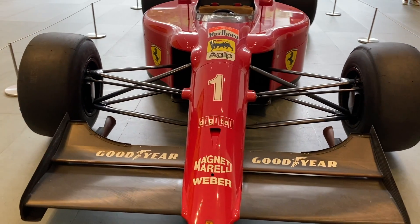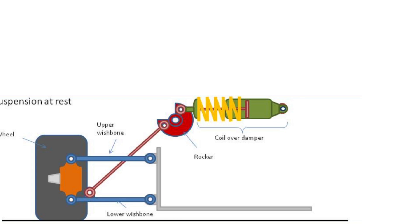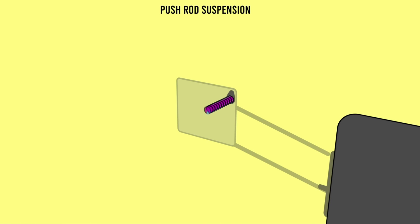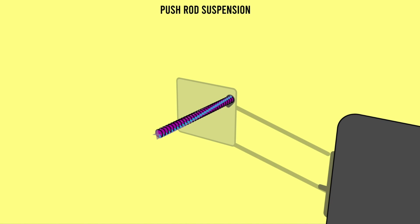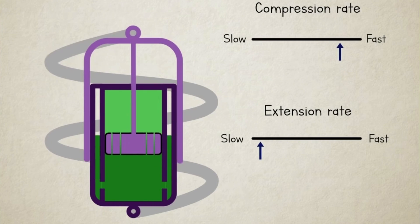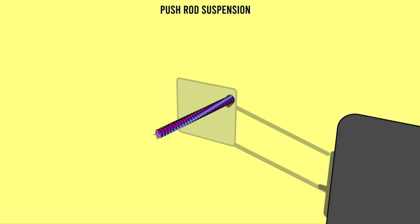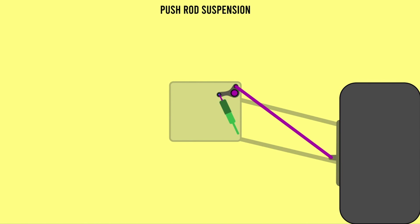We are looking at the front end of the car. Wheels are structurally mounted to the chassis via wishbones and the push rod connects the wheel mounts to the rocker inside the front nose. As the wheel rides, the push rod rotates the rocker around an axis. The rocker is connected along this axis to a metal torsion bar fixed to the chassis at the other end. So as the rocker rotates, a twisting motion along the bar forms, to which the torsion bar resists and recoils firm like a spring. When released, the torsion bar springs back into its original shape. When people talk about springs of an F1 car, they are actually referring to its torsion bars. To prevent torsion bars springing back uncontrollably, fluid-filled pistons — called dampers or shock absorbers — are connected into and out of the torsion bar.